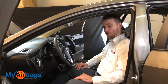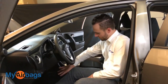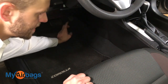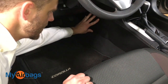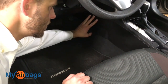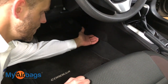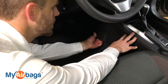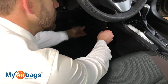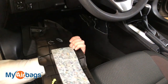You want to go ahead and move both front seats back — it's going to make it easier to move and work around. On the driver's side we have this panel right to the right of the acceleration and brake pedals. It kind of slides back a bit and then pulls right off — very easy. There are no bolts or screws holding it down. There's even a little area you can grab it and pull, and it just pops up by these plastic tabs and then pulls out.